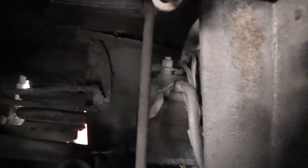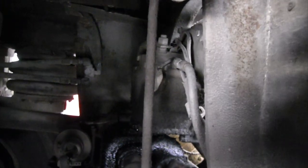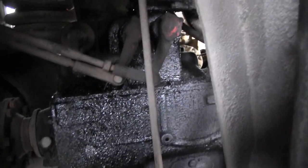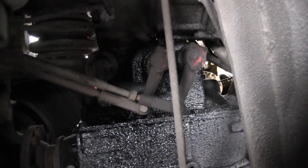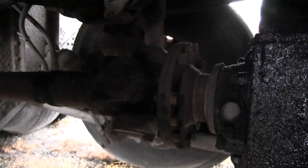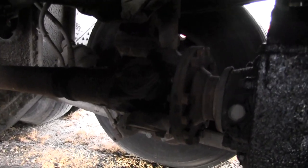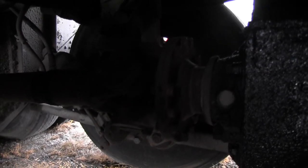And then I believe up here, that would be the generator, not an alternator. I've got to disconnect the lines off of that as well to pull it. So I've got my work cut out for me. I'm not entirely sure how to pull the linkage there from the clutch. Oh yes, and I also have to do the drive shaft. That would be the drive shaft right there. I may just pull out the engine straight and let the slip come out. Mark it first, obviously. I've also contemplated undoing the bolts there on the drive shaft that connect it to the transmission. So that's that.